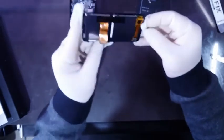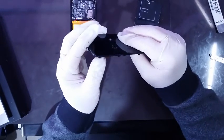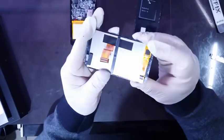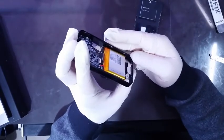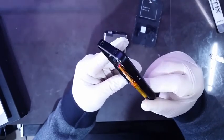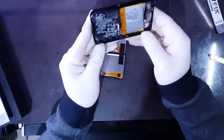And my last recommendation for you opening from the front is be careful. I tried to open it with heat, but I cannot see glue. So probably this frame, oh yeah, there's a little glue here, but most probably the whole support of the frame is through these tabs. These tabs hold the frame. Oh yeah, there's a little glue in the tabs, but the premise is the LCD is fit with the tabs onto the frame. There are notches on the frame for the LCD, and yeah, there is little, I don't know, hot glue on the tabs. So yeah, maybe heat it a little.